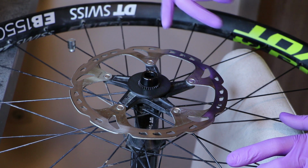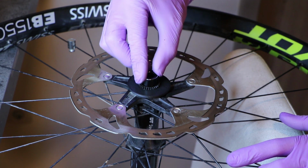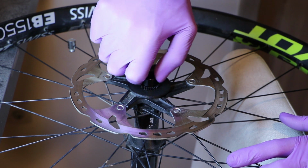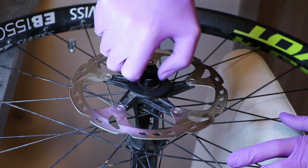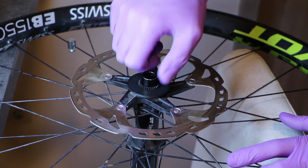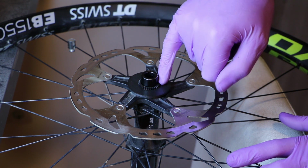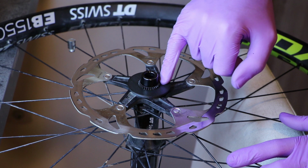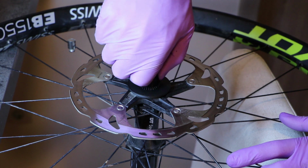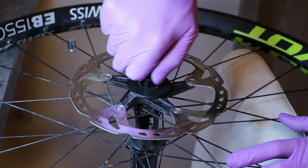One more thing to do after you have installed the Sun Gear is to try and turn the end cap. Okay, it should be turning just as smoothly as it was before. If there is any sound of scraping on the plastic, that means there is like a little protrusion or some defect during 3D printing here, because the gap is very, very small, but that will wear itself out over time. Absolutely no sound of scraping plastic on plastic.